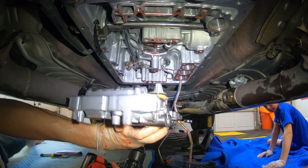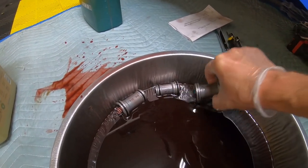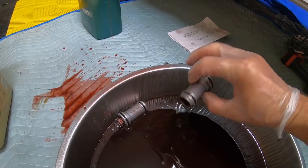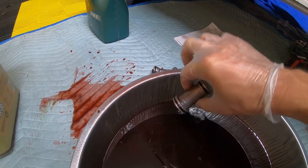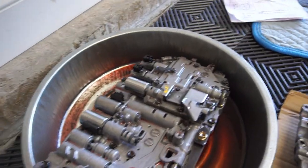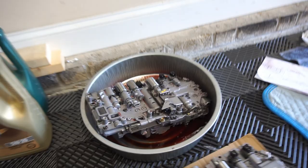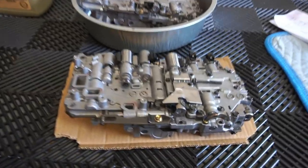Those are the key accumulators — here's some of the parts that fell in, and there are a few more over there under the car. Here's the new valve body right there, and the old one is here in the oil pan. I actually put some paint pen on it just so I didn't accidentally put in the old one. I know that sounds silly, but they are exactly the same and it's not like I can tell the difference from the outside.